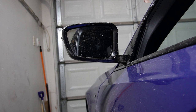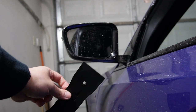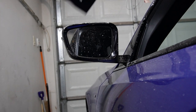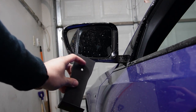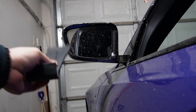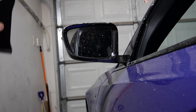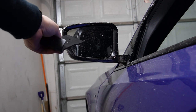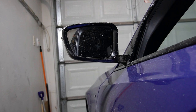You'll have a similar side mirror glass and mirror housing on most G series, except for the X which is the SUV series. I'm using a wider trim removal tool so I have more leverage when prying the glass. I've already tried replacing this mirror glass with an off-brand unit, which I'm not happy with — the indicator light is barely visible most of the time.